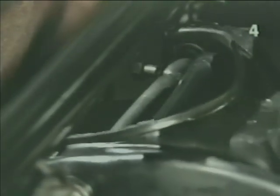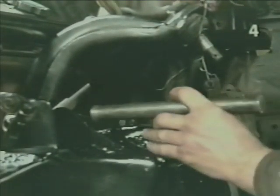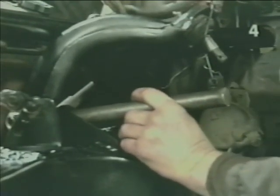Be sure to thoroughly lubricate the entire length of the bolt before installation. With the nuts installed on the studs and the control arm lifted, we have access to the head of the studs. Now we can reseat them into their mount with a drift and a hammer.